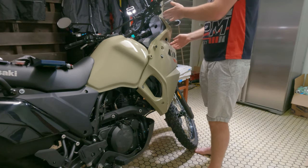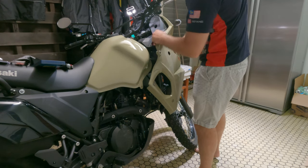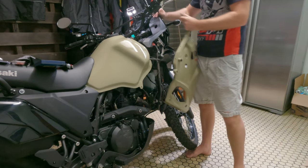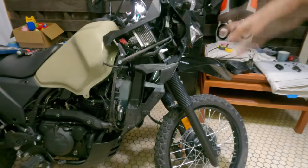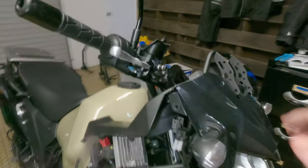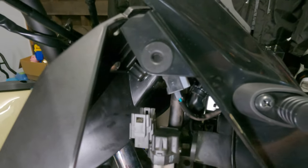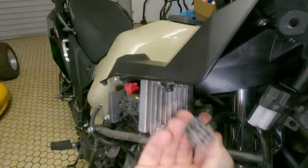At the front there are two rubber grommets that the fairing pushes into, so you just have to wiggle it out — be careful not to damage the fairing. There's one there and one there — that's your naked KLR everyone. Make sure the grommets don't come out and if they do just push them back in. I've also taken off the windscreen and two bolts here to give me more access, because if you pull that back, those are the cables we're going to hook this socket up to — just some bullet terminals already installed on the bike. This grey thing here is where we hook up the relay; it's really simple to take off, you just push a button there.